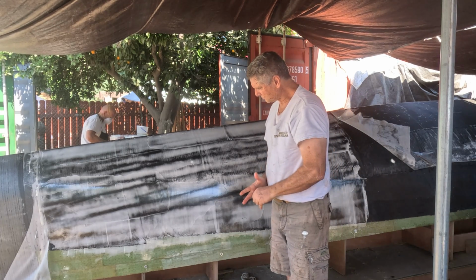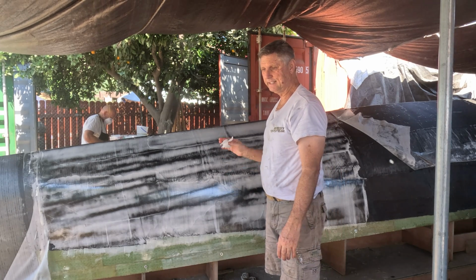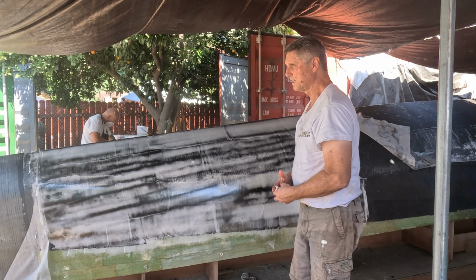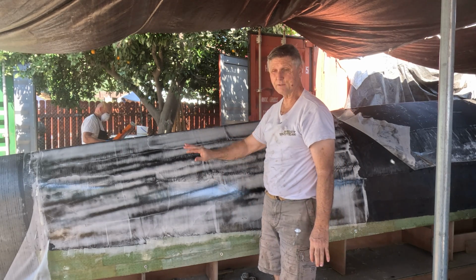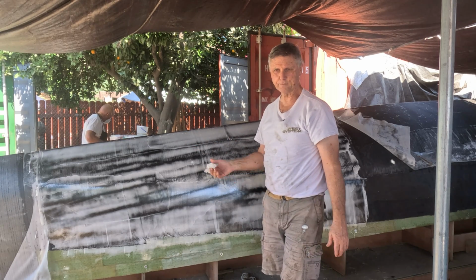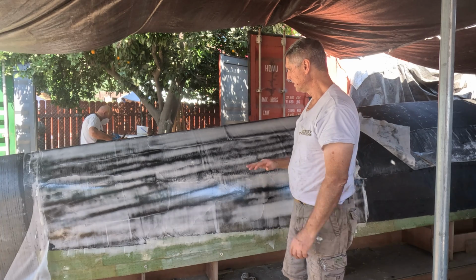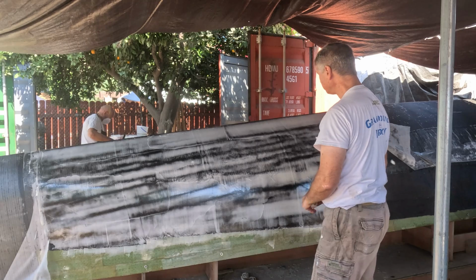So it's going to take, I have no idea how many, but at least 3 applications and sand, application, sand, application, sand, and then we'll see how we are. At that point, we'll probably dye the surface, and when we sand it, we'll be able to see any high or low spots. But there's no sense in that to begin with, because we know there's still going to be low spots in here. So this is going in stages. We'll get it improved over time.